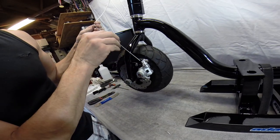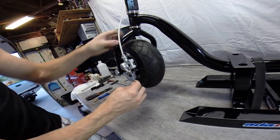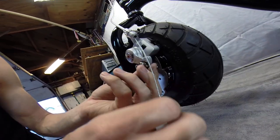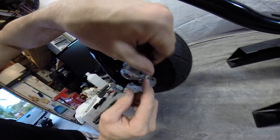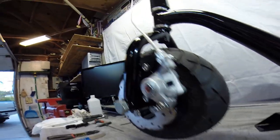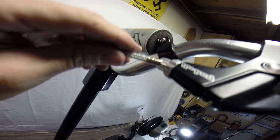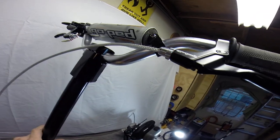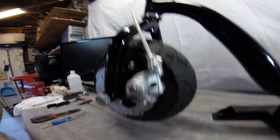Now our cable — we're going to run it through here. Once you've run it through, this little guy down here: we're going to run this cable right through here and it should sit in this little groove right in here. So make sure the cable is seated in the caliper groove. Also make sure it's not falling out at the top — make sure that is in position and everything is tight in there before we go and start adjusting our caliper.